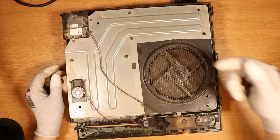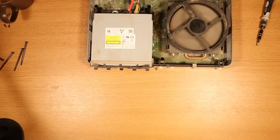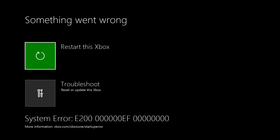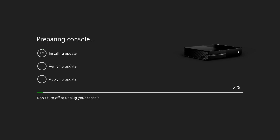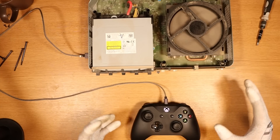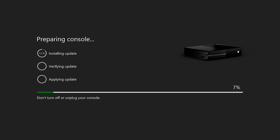It's just come on — just took a very, very long time to boot. After a while we seem to have the E200 error. I'm going to plug OSU1 in and see if that fixes it. OSU1 seems to be working its magic. For those who don't know, it's an offline file that basically resets the whole Xbox for the hard drive. If this doesn't work, I will swap out the hard drive and see if we get a different result.